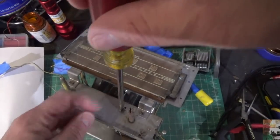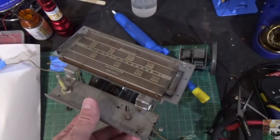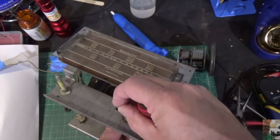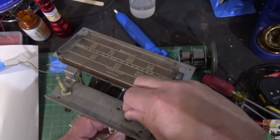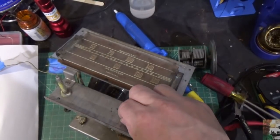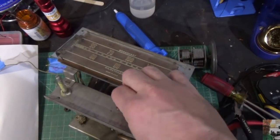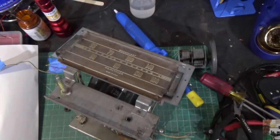The next thing we're going to do is take off this tuning mechanism because it needs to be cleaned. It's really just two screws — there's one and there's two — and this unit just pulls right out. There's so much gunk and grime in there, and there's a C-ring. We're going to pull that out and you'll see there is a little bit of rust, so we're going to drop that in the Evaporust as well. Whenever you do things like this, always put the screws back so you don't lose them.